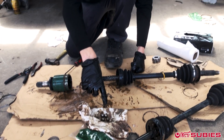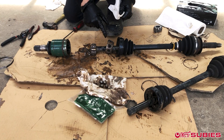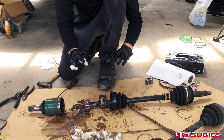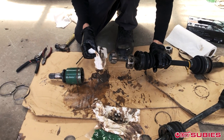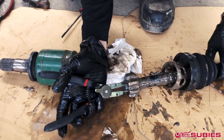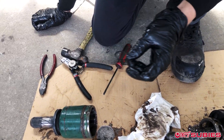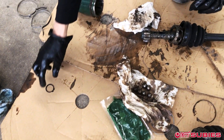This is what we would have sent to Dave's Custom Races. Pay attention to the orientation of the cage — it tapers down like this, so when you put it on you don't want to flip it. Revealing the C-clip, or snap ring, whatever you want to call it, here on the end of the shaft. Using your snap ring pliers, you'll get it off just like that. We won't use this one because the diameter of this shaft is bigger, so it won't help us out.